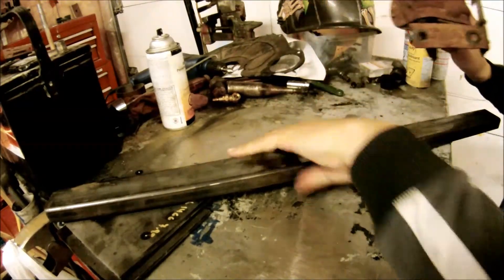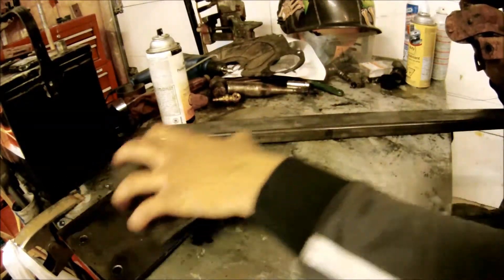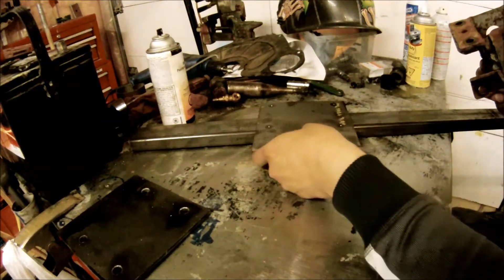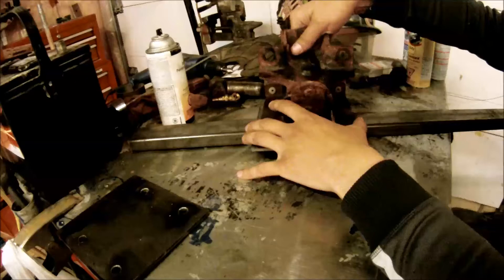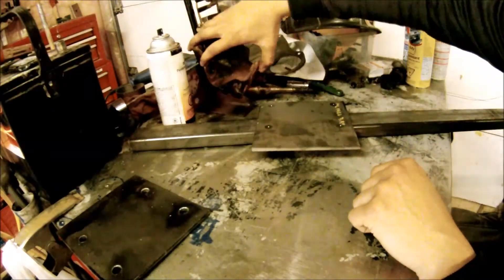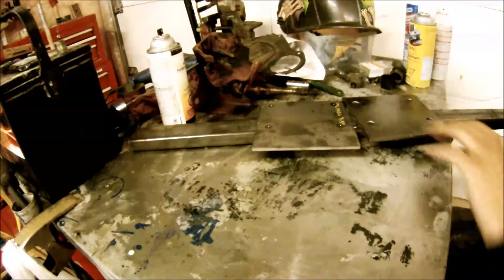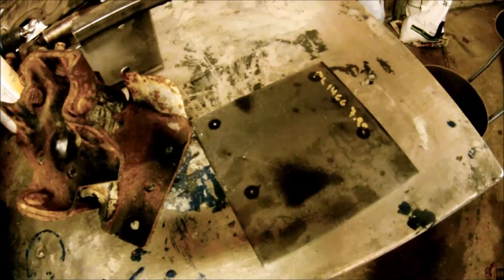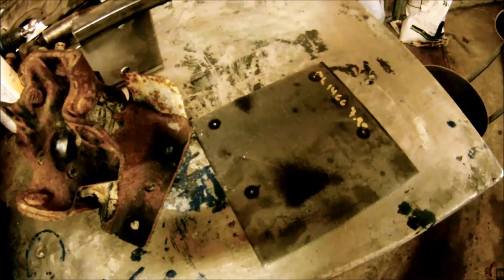The reason I have this is because we've gotten some quarter inch steel plate, lay it down on top, take a little spray paint, spray over the holes, punch them out, and then you're going to want to drill them out to give yourself templates for making the new motor mount. Once you've used some spray paint to spray over top your original motor mount, you're going to want to take a center punch and mark the center of each hole.